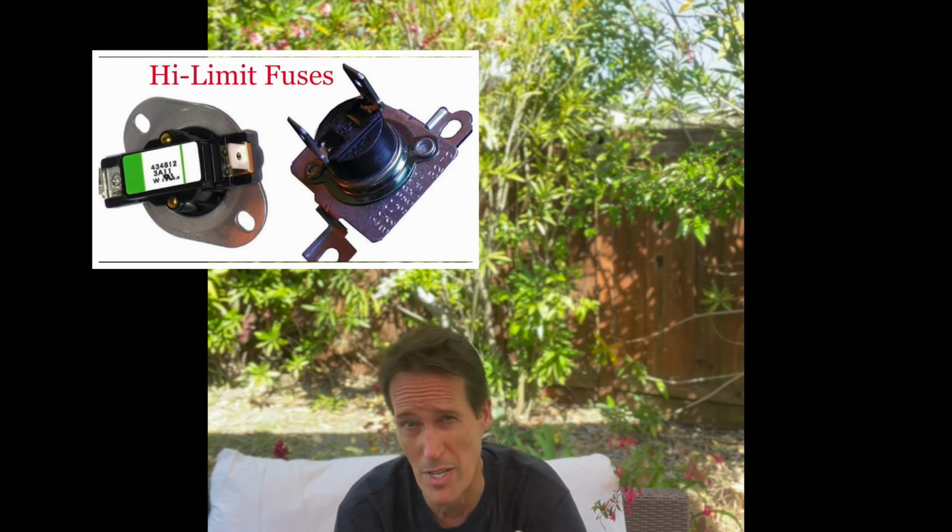But then when you start running your dryer, it tumbles, but it never heats up. So usually that would be the high limit is tripped or the thermal fuse is tripped, and it's really easy to fix. We'll put some links in the description below to videos that show how to do that. Those parts, by the way, the high limits or thermal fuses, are really cheap. Usually get them at Amazon, it's a good source, but really inexpensive and easy to replace.